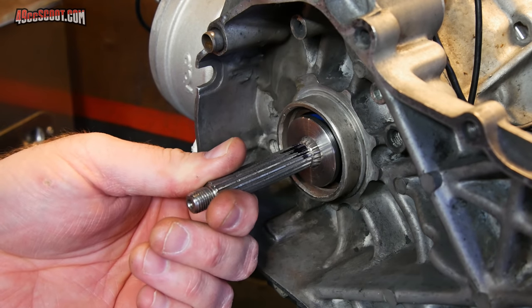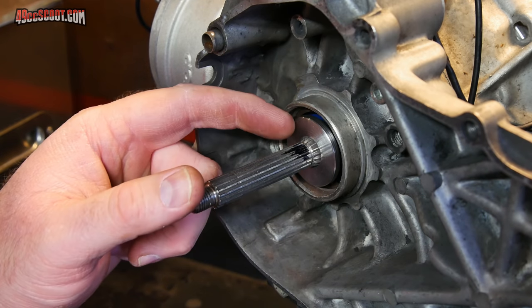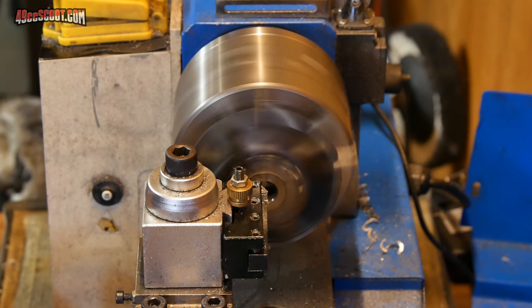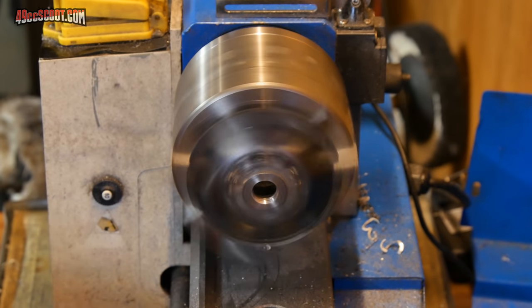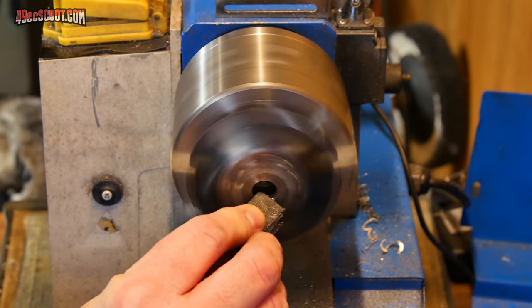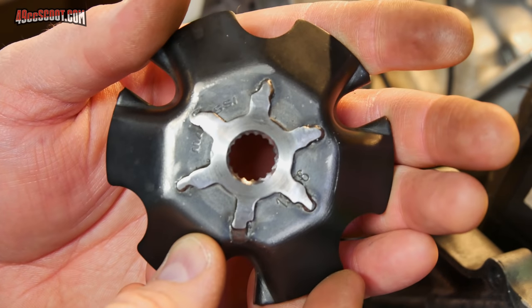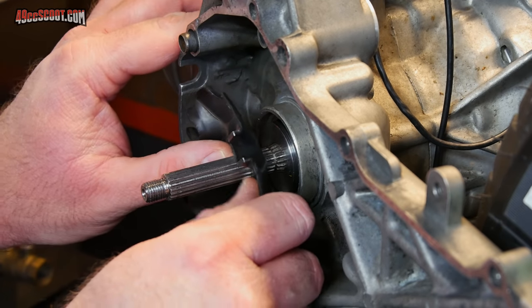It looks like I'm pretty close now. You can see the edge of that black mark isn't too far off of where the crank is scored. Cutting that with a bit of a taper seems to work, and this goes back and butts up against that spacer.